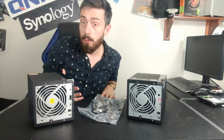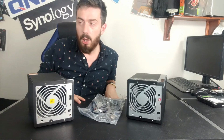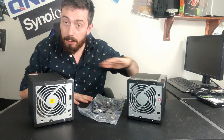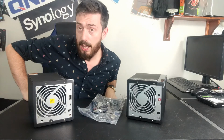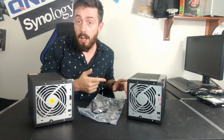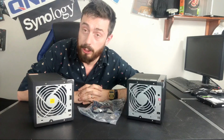And if that sounds like something you want to take advantage of, maybe you're running an AI setup or a flash setup, definitely consider this one. But if not, if you're a home user or a small business user that just needs a bit more storage and didn't intend to use media where that 500 meg connection between it and the NAS would prove a problem, then definitely go for that one. And ultimately, either one of these is a great NAS expansion. It's just a lot easier to understand the entire range when you know that TR means hardware RAID and TL means proprietary SAS connection.